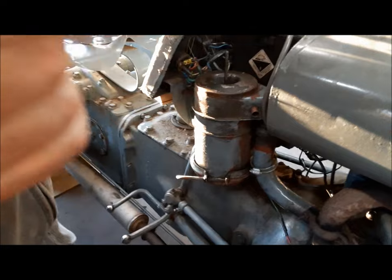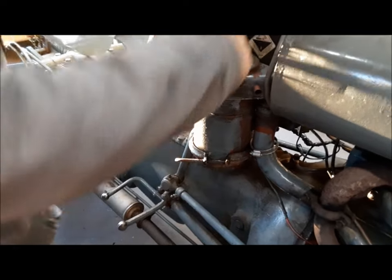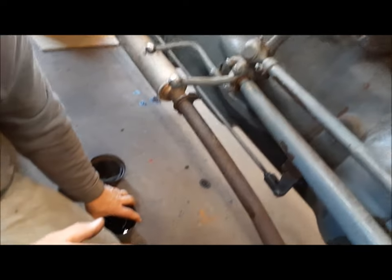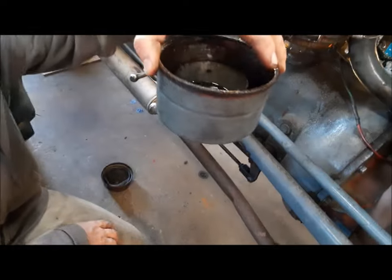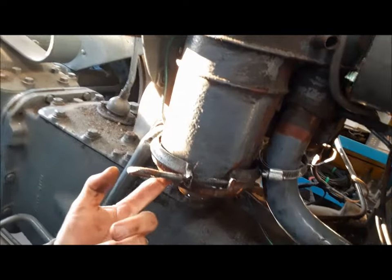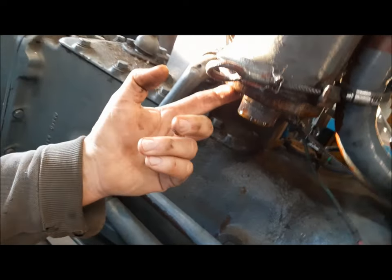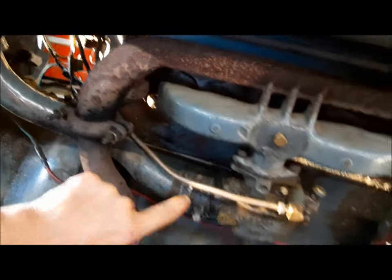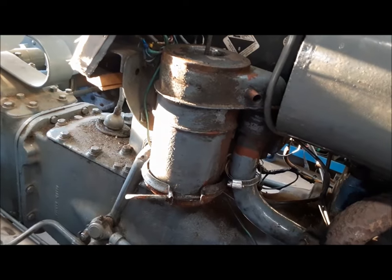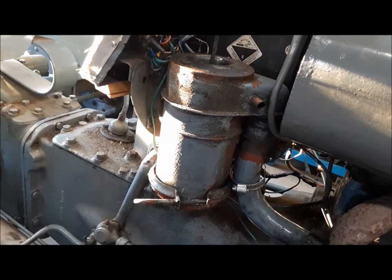The intake air goes through the louvers in the cap, down through a little pipe, and gurgles through the oil, which grabs all the dust and crap out of it. Oil bath is absolutely the most efficient air cleaner there is. Then it goes up through the steel wool packing and out down through into the carburetor. This open section here — I think that's because this is an air cleaner from a TEA, not a TE.